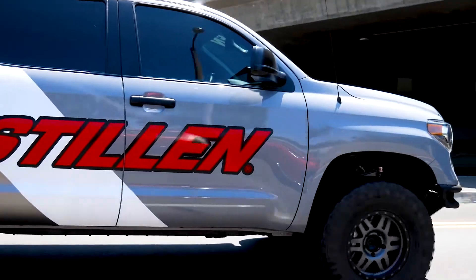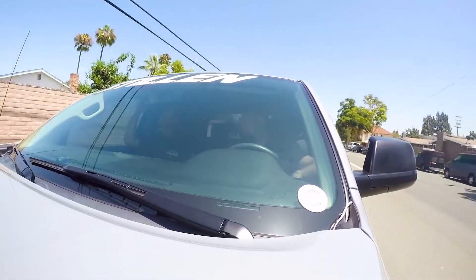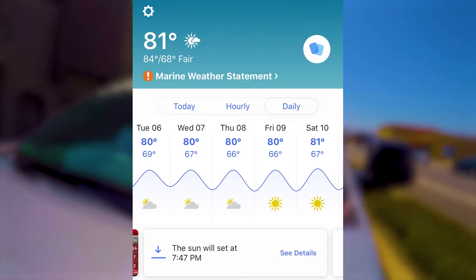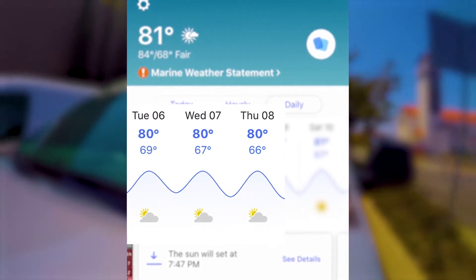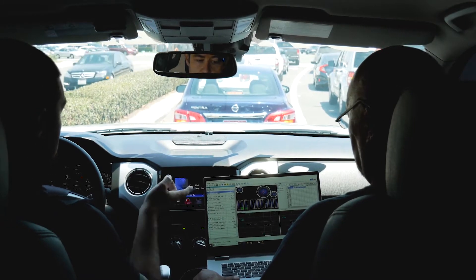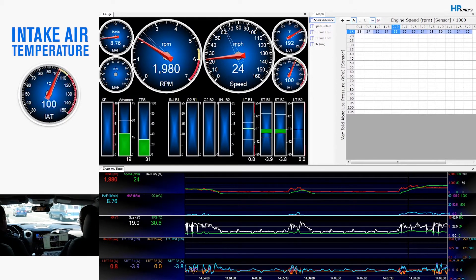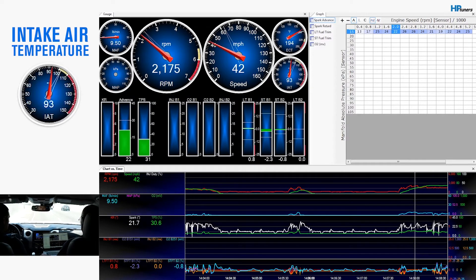To set up our challenge, we selected a driving course that represents an average commute, testing the vehicle in stop-and-go traffic as well as steady-state highway speeds. We began the tests at the same time of day to keep ambient air temperature and traffic conditions as consistent as possible. The weather forecast called for 80 degrees for all three days — actual temperatures varied by only two degrees, still within a reasonable range. During factory intake testing, the highest recorded intake air temperature was 102 degrees, recorded after 15 minutes of city driving right before the freeway entrance. Once on the highway, it took about one minute and 45 seconds for intake air temperature to get within three degrees of ambient.